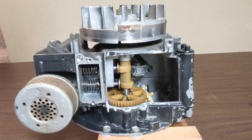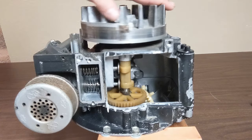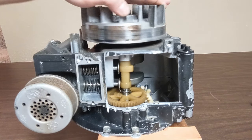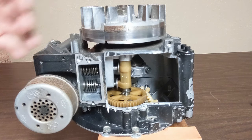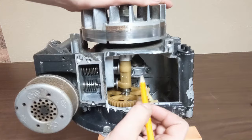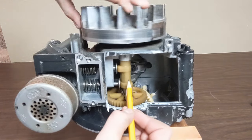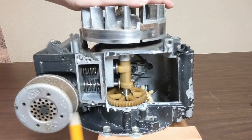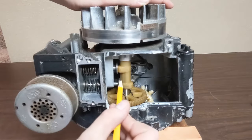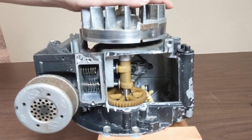Now let's take a look at some of the different parts of the engine. We'll start with the flywheel up here. This is what helps keep the engine turning between each power stroke — it's got some weight to it and that gives the engine momentum to keep turning. It's connected directly to the crankshaft and spins as one unit. The crankshaft is basically a crank that makes the piston move back and forth in the cylinder, and it comes down and over to the connecting rod, then back over and down as the output shaft that's connected to the blade on your lawn mower.